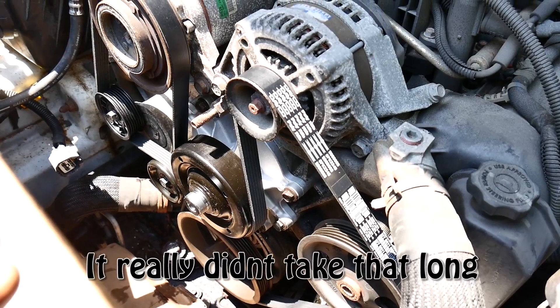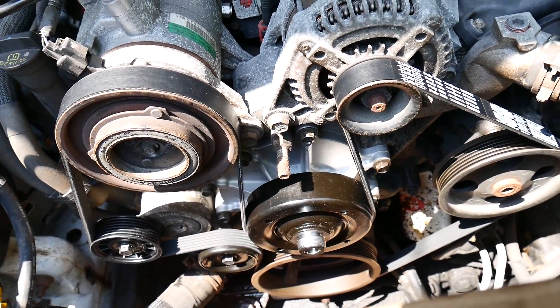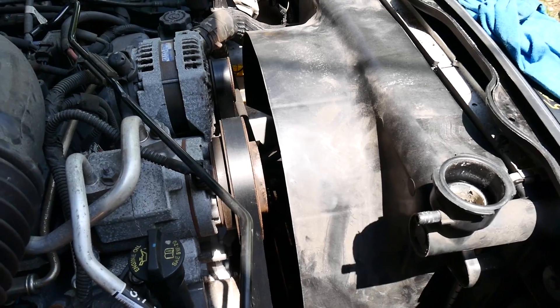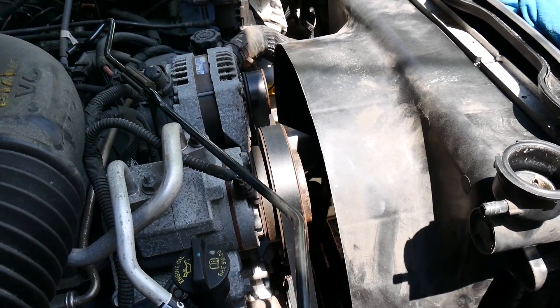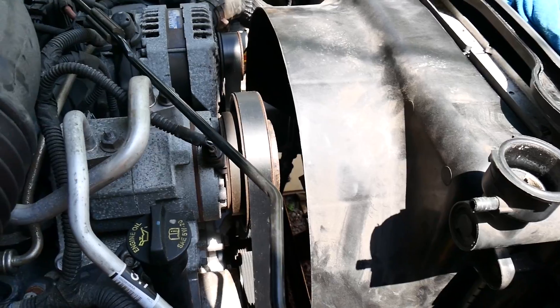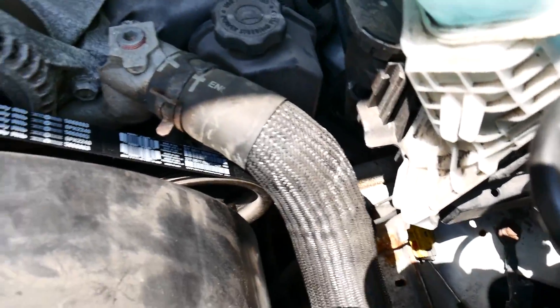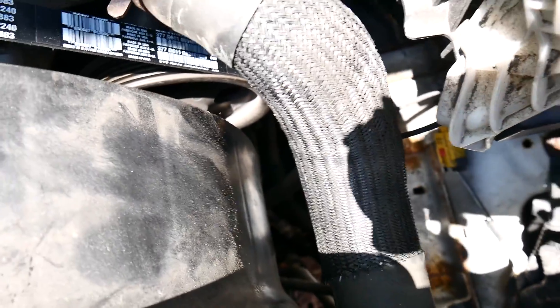That looks right. I remembered how it was when I took it off but I did double-check everything. I'm going to go ahead and put the fan back in and put it back together. So far it's going back together easier than it came apart — probably most of that was because of me finding my way. I've never done something like this before on a Jeep but I do have a mechanical background, so it wasn't too bad. Just two 8mm bolts on the top, and on the bottom it hooks into a plastic tab. I should mention there is a bolt clamping the two transmission lines to the bottom of the fan assembly — you've got to put that bolt back in. And of course I forgot to tighten the petcock before I put it together, so I just climbed under there and tightened it up.